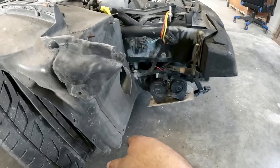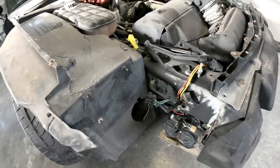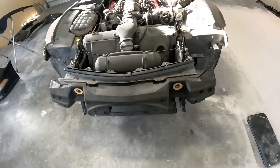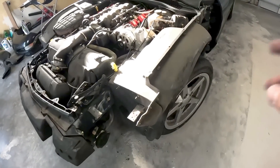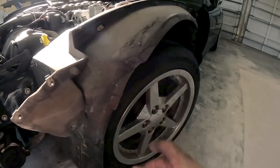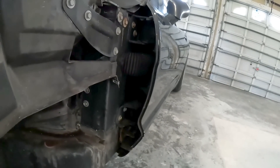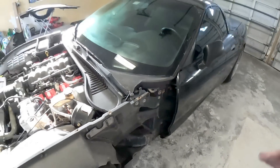You saw that there are air horns here — well, they are coming off. But don't forget, this is a South Florida car, so sometimes they are needed. Moving along to the front bumper — everything came off pretty good. There were a couple of plastic retainer clips behind the license plate that we figured out would come out and then the bumper released. Over on this side, everything looks really tidy. You can see the speed clips are still here. This fender liner looks really sturdy. There was one bolt that was a little bit hard to get to right in here, so if you guys have any tips or tricks when we go to put it back on, how to reach in there to get that one — it was pretty tough.